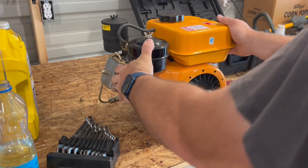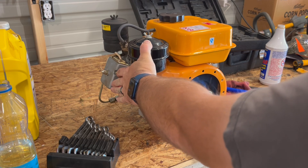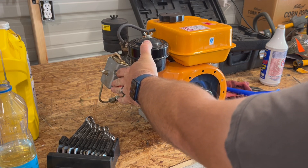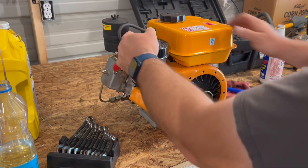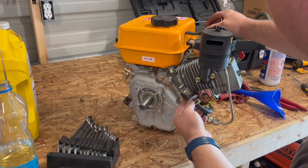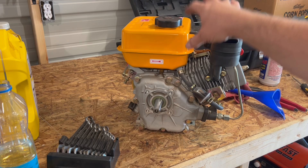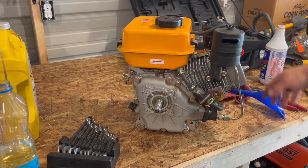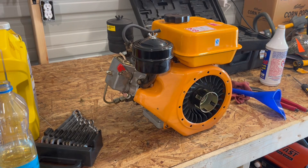Compression lever down a little bit, we'll get it spinning to get that fuel up in there in the injector. Okay, check everything, make sure we got fuel — yep. You can see right here there's a little bit of the old mixed fuel, but like I said it's mostly vegetable oil right now. Now let's take this outside and test it.